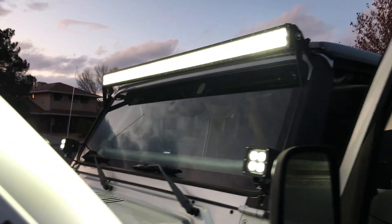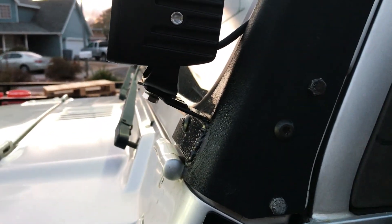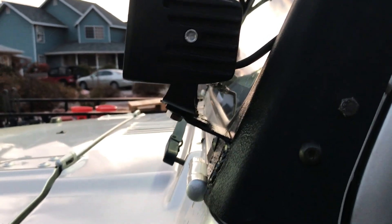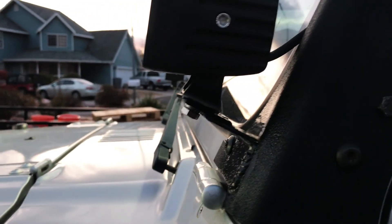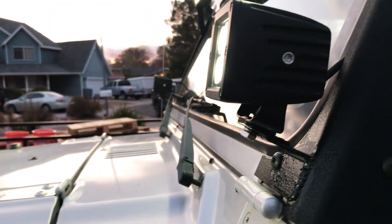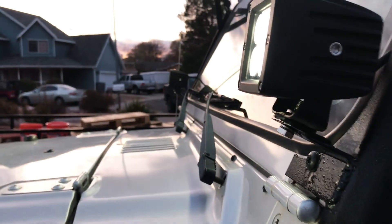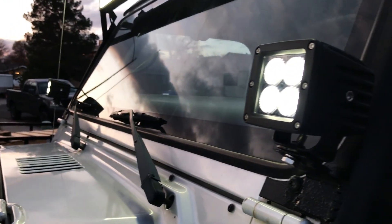This is what they look like with them on — look pretty good. Drop the hood down. One thing I didn't take into consideration when I was making this was the angle of the window, the windshield. I took a piece of angle iron and welded it on this bracket right here, and I didn't realize how steep it was. These lights are angled too far forward as much as they can go and they're still aimed pretty high. So we'll have to find another way to bring them down — I think I might heat them up and bend them down. Anyway, it turned out pretty good. They were on sale for nineteen bucks a piece, two of them — forty dollars. Then I had to buy a new switch and a relay, so that's probably about fifty-five dollars worth of parts. I had the wire and the connectors so I had to put it together myself. I'm happy with the way it turned out, other than the angle of the lights.